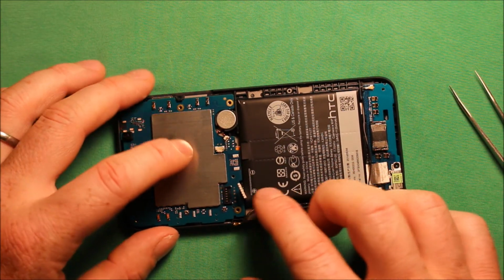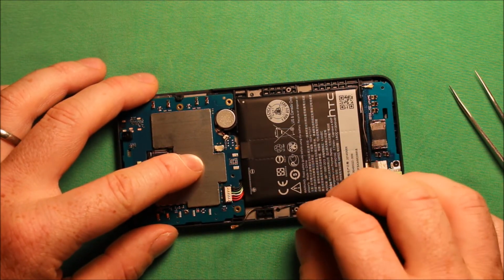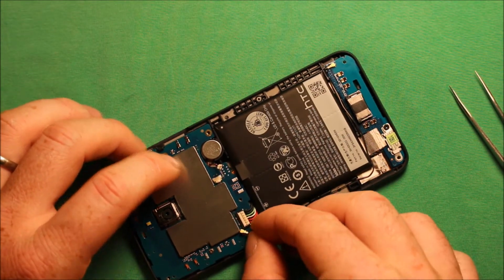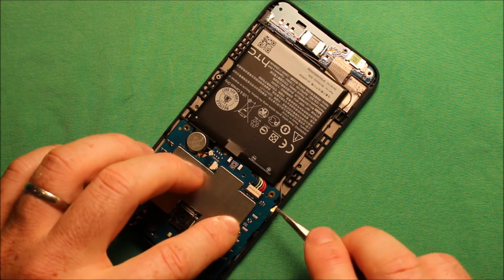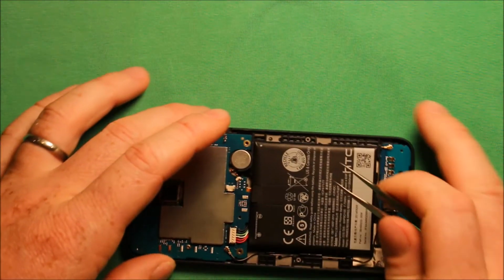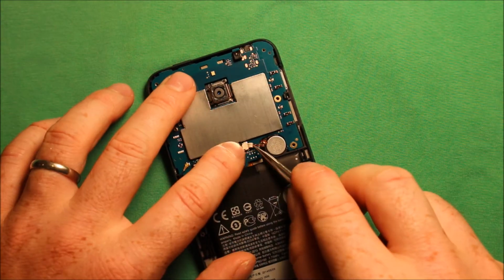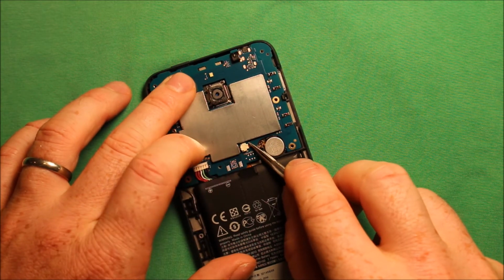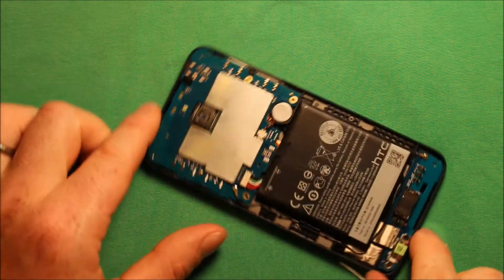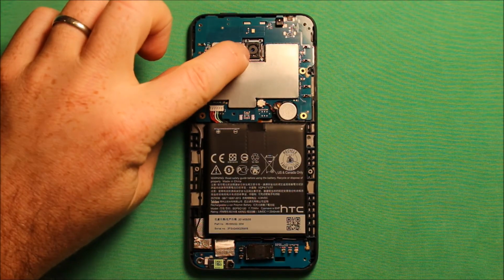So then to reconnect, you can go ahead and reconnect the battery. Just push that right down in like it goes. And then go ahead and connect the wire here for the antenna wire. Sometimes it's a little easier to have something like the tweezers to hang on to them, and then to get them started square. And then you'll have to turn this the right way. And so what you'll want to do is just push that in, right straight in there. And you're all connected.